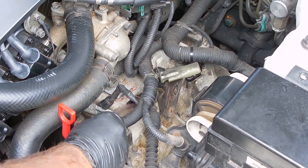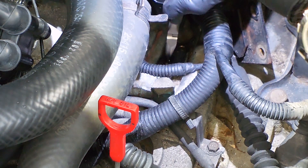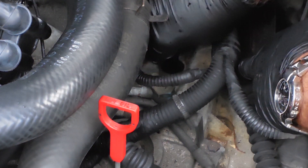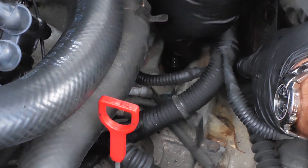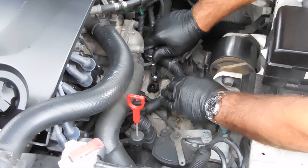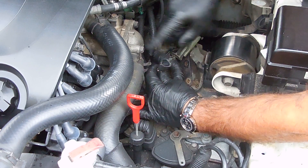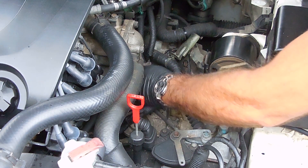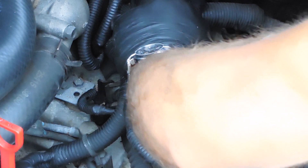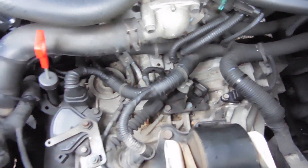With the area clean and the bolt removed, because this sensor is recessed I'm going to grab it with needle-nose pliers and pull straight up. You can see it come right out of the transmission. The new one is lubricated — carefully center it and push straight down until you feel it pop into position. Put the bolt back and tighten it down securely, then push the connector down and gently pull up to make sure it's locked. Finally, bolt the plate back onto the top of the transmission — be careful not to over-tighten into aluminum as you can easily strip the threads.